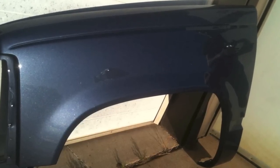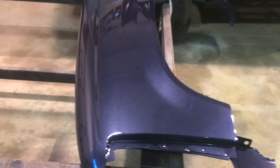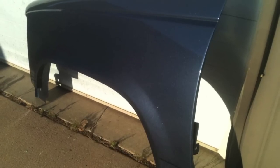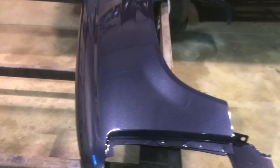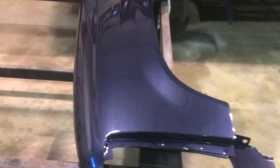I've got a video clip here showing me applying the last coat of clear. Something happened to the first coat video clip, so I'll just show some pictures for that part. But anyway, this ceramic clear sprayed out really nice — this is the first time I ever used it. We have ceramic clear because some cars like Mercedes and higher-end cars are using ceramic clear from the factory. It's a much harder clear, supposed to be more resistant — scuffs and light abrasions are not supposed to damage it like normal clear. They're having these sprayed from the factory, so you need to be able to spray it to restore pre-accident condition. That's why they came out with this ceramic clear. I found it sprays really nice — the clear flowed on beautifully.